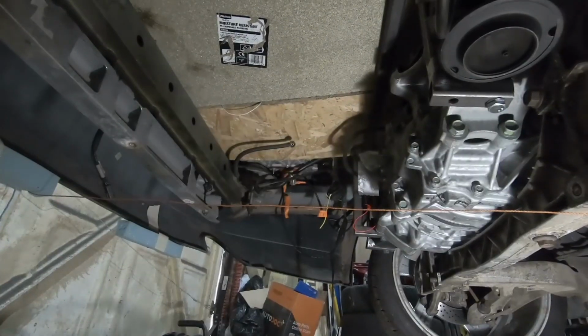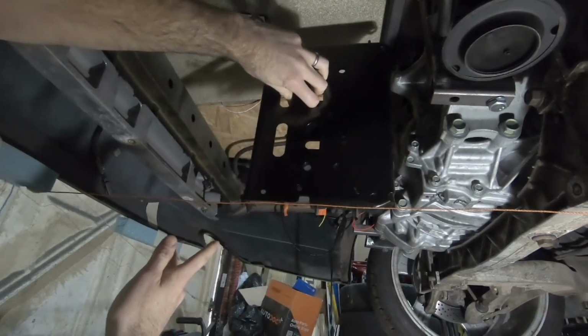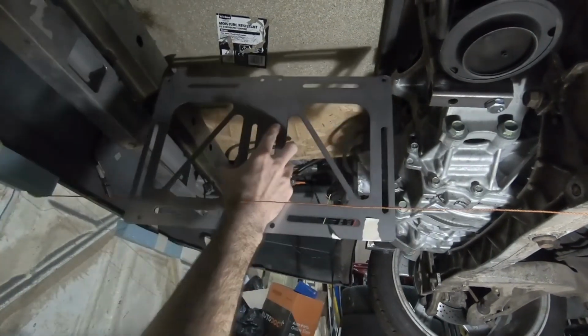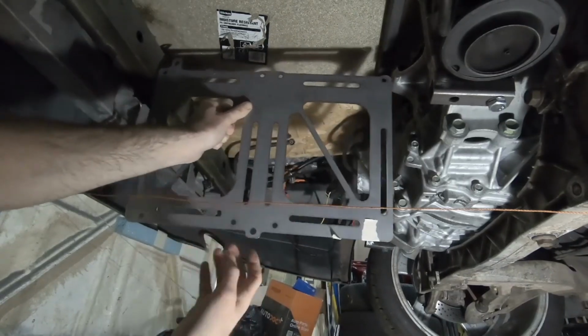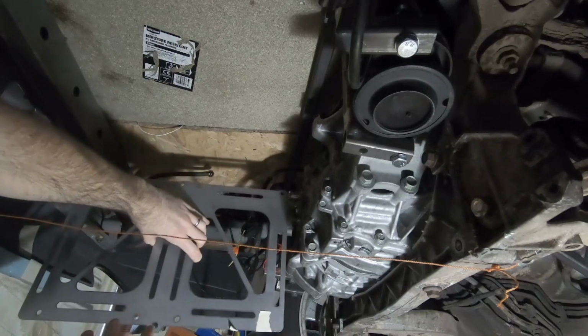We did an investigation of the battery pack, and then we stripped it back into its component parts and stored them around the garage. With the battery in its component parts, I had the modules available, and it meant I could get the car back into the garage and start trying to measure and visualize how I was going to fit the battery pack into the car. Holding things up, seeing how many wide I could get, what lengths they were, where they were going to foul on things. I did a lot of measurements, of the volume the battery would take up, but also the weight and weight distribution, just to make sure that whatever I came up with wasn't going to break the car, or certainly break the spirit of the car in terms of totally ruining the handling.